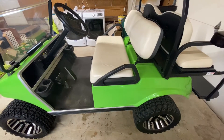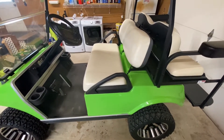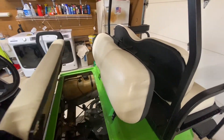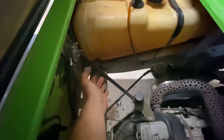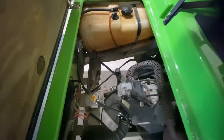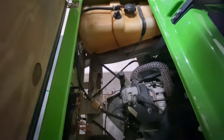There are a couple little side effects of lifting up a cart six inches and putting heavy duty leaf springs on that I just didn't see any information on or had anybody talk about their personal experience online about. We noticed that after the build was done, otherwise I would have captured it. But if you look right here, you can see that little banjo string line right there — well, that's my fuel line. That's one of the fuel lines anyways. I believe this is a vacuum for the fuel line and it's pretty taut. That's a result of the engine dropping down essentially six plus inches and the slack that I had in that line just virtually disappeared.